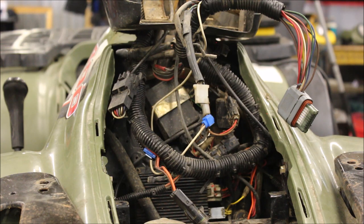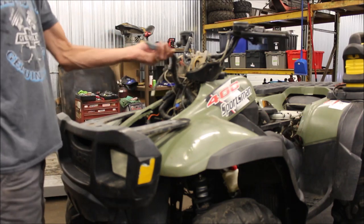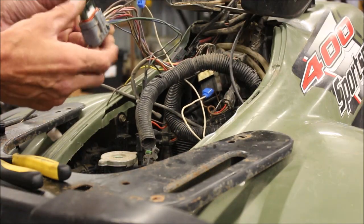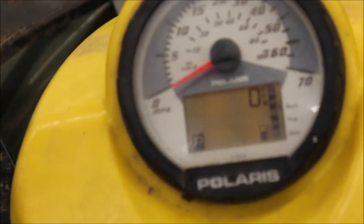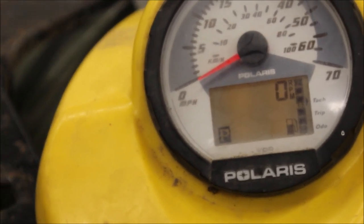If I was going to turn around and sell this I'd do it right, but this one I'm probably going to hang on to. Now you may be asking — that sounds great, but my hot light is still flashing on the speedometer. I bypassed the fan but that's still flashing. Well, let me show you a little shortcut. Grab the wiring harness down from your speedo, get that disconnected, and look for the blue wire with the white stripe on it. Take the blue and white wire off the harness going up to the speedometer, cut it — and no more hot flashing light. Problem solved.